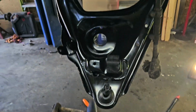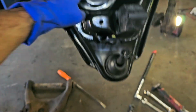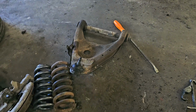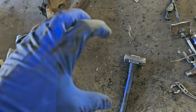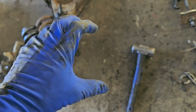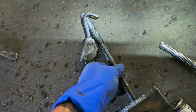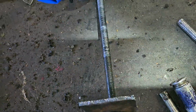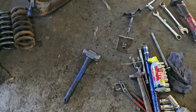Just like these are very, very tight actually. I'm gonna probably have to use a ratchet strap to get it up. But we're gonna mount our spring on the plate just like we did when we pulled it off that one. Other than the brand new, make sure the small side's up. Mount it the same way. Leave yourself maybe a third of the top of that spring, because that thing's gonna have to maneuver getting out as far as the puller. And I'll show you that in a minute. We're gonna get the bottom situated and then work on the top.